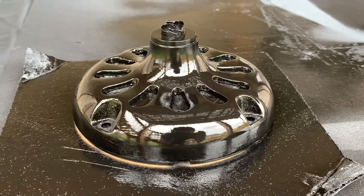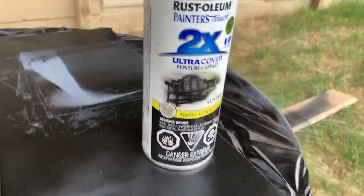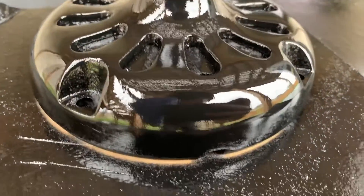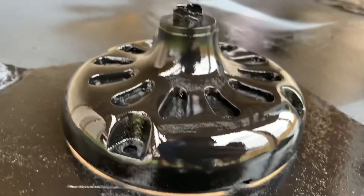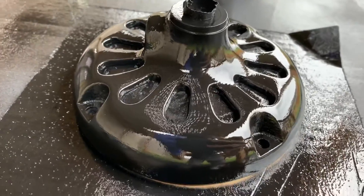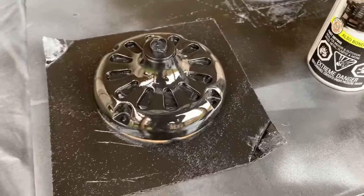Here's a shot of the rear motor housing after two coats of gloss black — it's looking pretty good. There's some orange peel on it but I plan on just wet sanding and polishing it out. That gloss looks so good, and underneath there are three coats of gray primer. I'm going to apply one more coat — should be the third one.